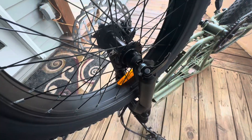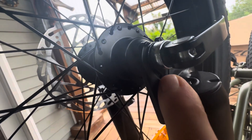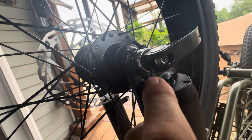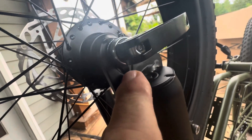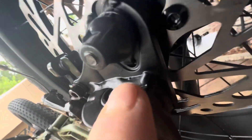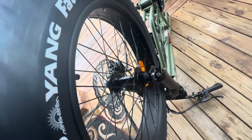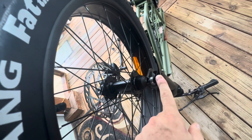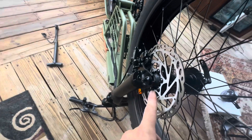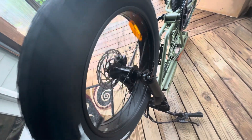This is designed so you can take the tire off anytime — a quick removal if you don't want somebody stealing your tire. I put the lever on the non-brake side. There's a metal catch that goes into a hole on the inner side — you just line it up, same thing on the other side. Then you hand-tighten the screw down, flip the bar down and it tightens right up. The manual didn't say which side this was supposed to be on, so I put the lever on the non-brake side and a nut on the brake side. It spins just fine with no catching.